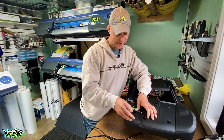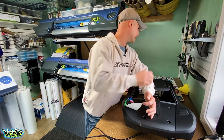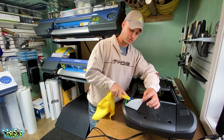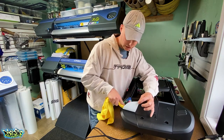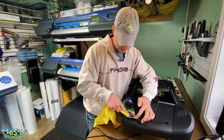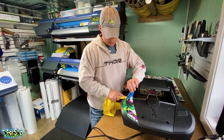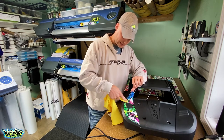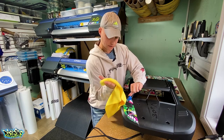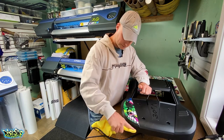Try not to pull it back up if you can help it, especially on a dry apply. That does not apply to a wet apply because you're not making initial contact until you squeegee the product out. I'm wrapping my 3M cloth around my finger to reduce friction, then going back and forth in a sweeping motion. Once this product is aligned, it should fall right into place. I go in a rolling fashion to get the air out, then finish with my finger.